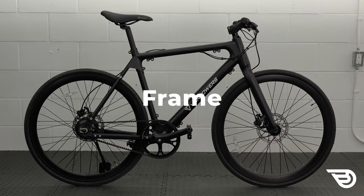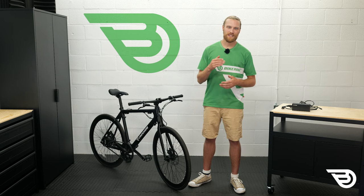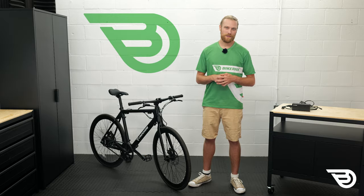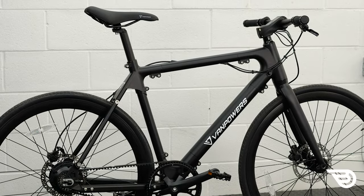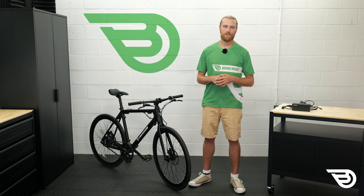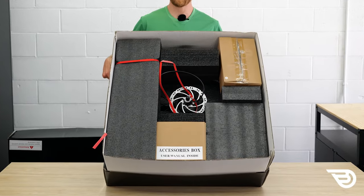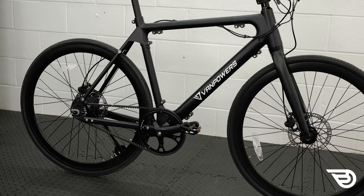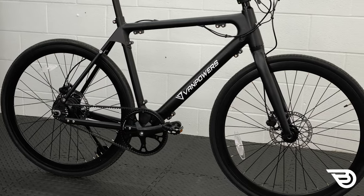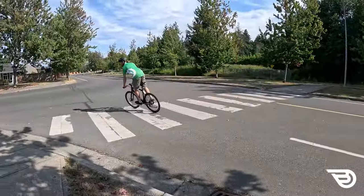Talking about that frame and the bike's geometry: the CityVanture features a different frame style and a unique feature that sets it apart from all other bikes on the market. They chose to use a tenon and mortise construction method. The brand claims that it reduces the number of frames rejected in the construction process and offers superior durability. It also means they can deliver the bike in a smaller package, and you can assemble the entire device yourself. The frame when assembled is solid and unique. While testing the unit I found no issue with the construction style or its ability to withstand the abuse of riding.